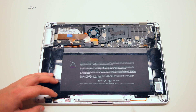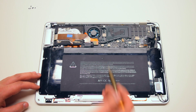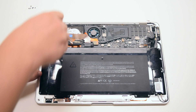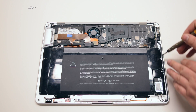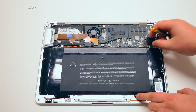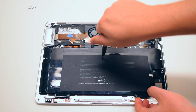The battery is held in with nine Phillips head screws in various sizes. Go ahead and unscrew those screws about five to seven turns each, but leave them in their respective sockets. This will make it easier to just pull them out and place them into the new battery without having to worry about which screw goes where.